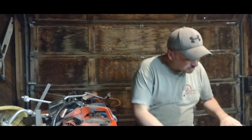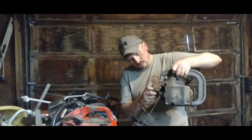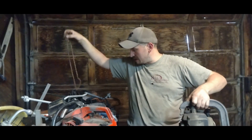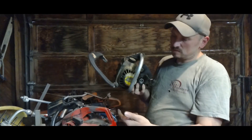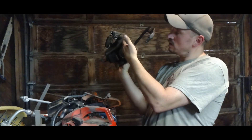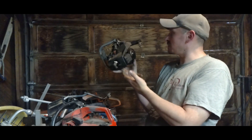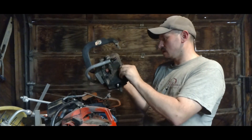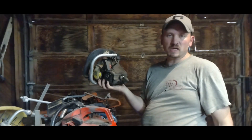Now we've got that out of the way. Sometimes when you're testing engines, it's better to just not have the chain or bar on it. I'll see how I can test it like this - I'll probably have to put some of the handle back and just omit the chain. There's no point having this on here if you're really focused on the engine running. Now I'm trying to split the rest of this apart. There's a parting line basically where the tanks are. I'm trying to take this whole back section off - with this metal outer aluminum casing. This must be old enough that it didn't use plastic. There are some plastic things like this side cover, but the main casing is not. I'm going to pull this whole thing off and see if I can get to the switch, the wiring, and check out the magnet.